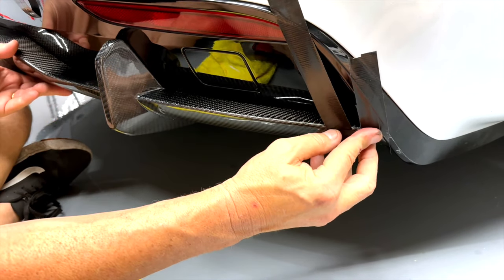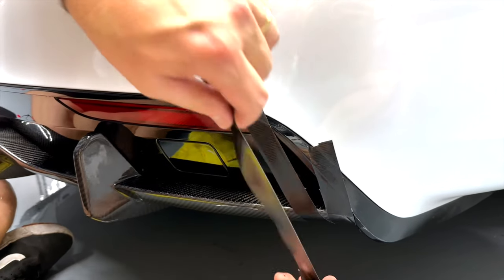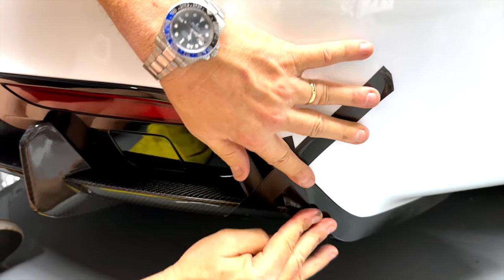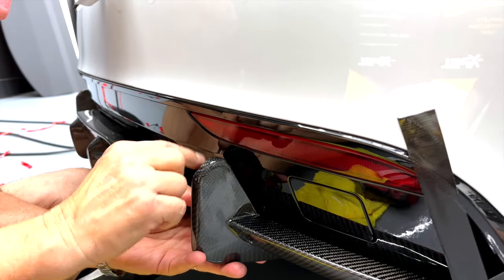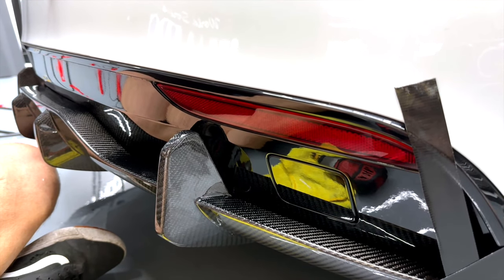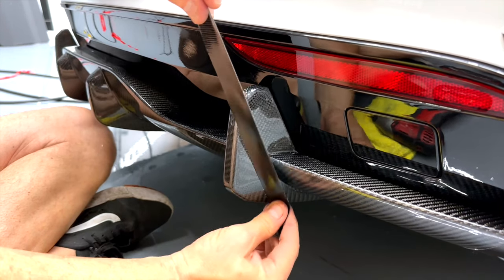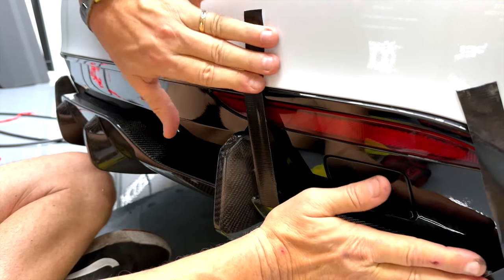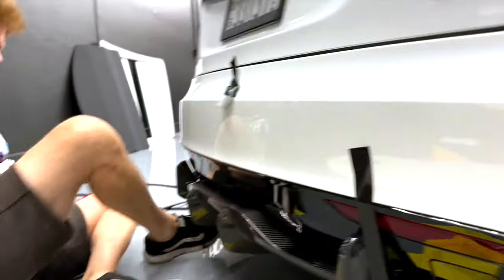If that's flushed, then we're going to keep going all the way to the other side. We really want to make sure it's going to dry out and the double-sided tape is going to adhere. We'll put some cross pressure on — stretch it good and pull it all the way up on the bumper. As long as this is not protruding out, it will be good. This piece here is already stuck, but you have time to push it on really strong. Then we're going to put another piece of tape on it, trying to make the final resting position a permanent one. We have some surface area — pull up. See this stretch? Up and on. Now this side is nice and secure. Let's move over to the other side and cut some more tape.